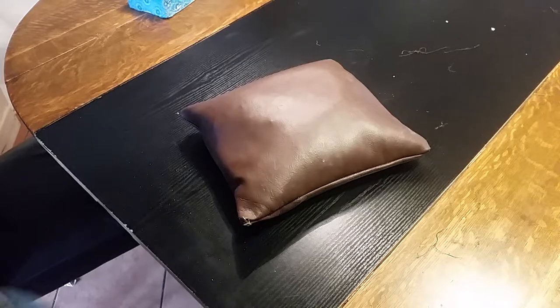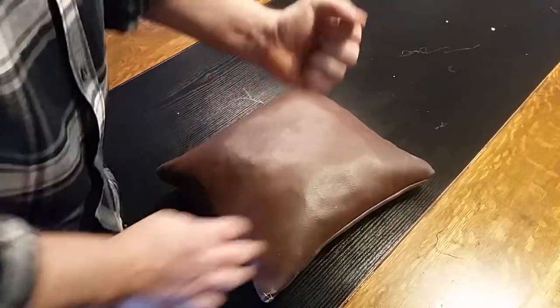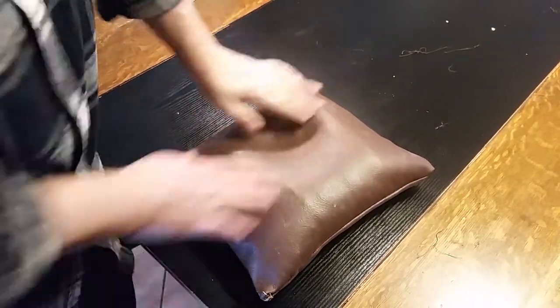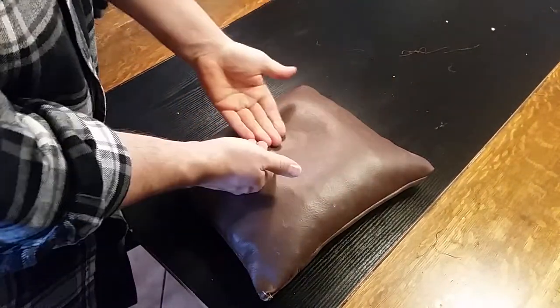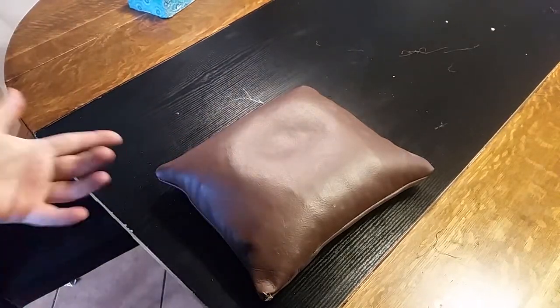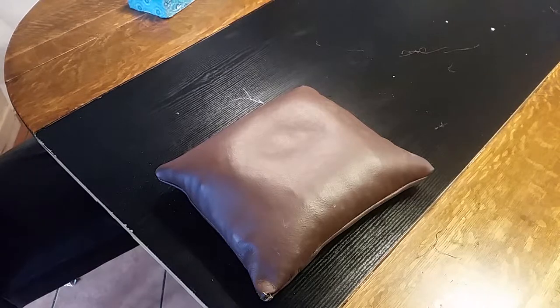So there you go — the world's heaviest pillow. It's very heavy. The idea: put your sheet metal on there, and then as you hit it, it deforms, leaving a crater and lets you shape your metal around it. I'm going to need it when I start replacing the rust in the inside wheel wells. I'd rather have an English wheel to shape that metal, but I don't, so I'll do it the old fashioned way with a beater bag.